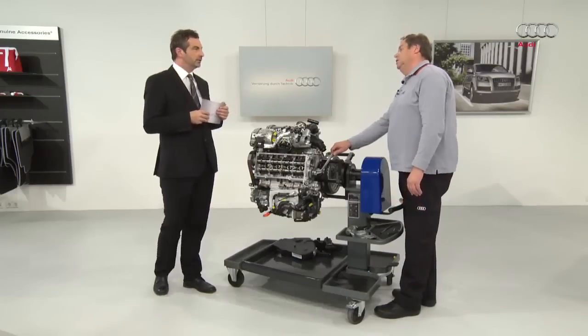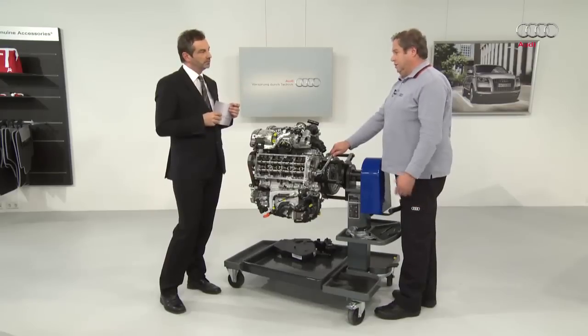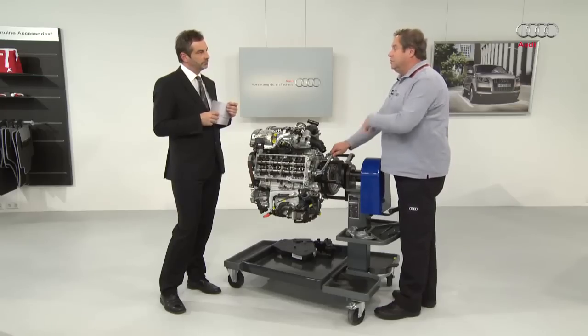So one valve opens while the other is still closed. If the engine now continues to turn, the closed valve is open for longer once it has opened. But you don't want this effect if you want more power — you don't want the valve to stay open for longer. If you want more power, you need to play with the outlet valve in the same way. This produces a better fill level and an improved flushing process. However, by keeping the valve open, aspirated gas returns to the outside. This occurs after reaching bottom dead center when compression actually starts. So the compression changes, which in turn reduces the pressure and the temperature in the combustion chamber. In this way, the amount of nitrogen oxide is reduced.